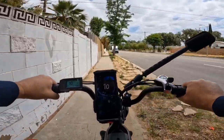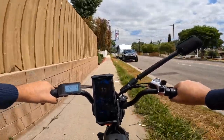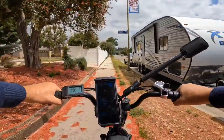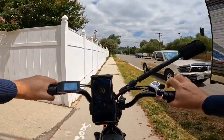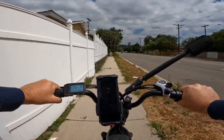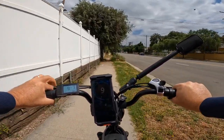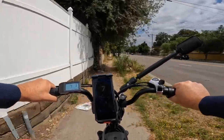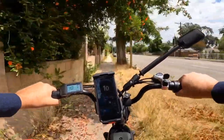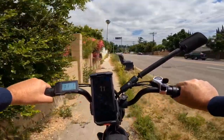I saw the fork actually did the job on the bumps — so it does work. The brakes are easy to fix if you don't want the squeaking noise. I actually kind of like the squeak sometimes, because if somebody's in front of me, I can just click the brake and they'll move away. The front one has no squeaking anymore — very quiet. Easy to fix. I'll put a link in the description with a spray — you just spray the brake pads and there will be no squeaking problem at all.